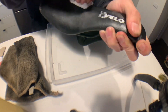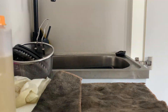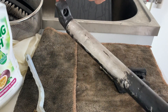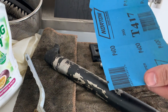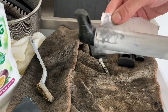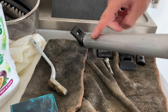Cleaning the rest of the parts — it wasn't too bad. I just used WD-40 to get rid of the stains, then some hand soap and moisturizer to finish it up. And then for the stem — WD-40 with the rust brush again to get rid of all the rust. For the seat post, just detergent and warm water. The seat post was pretty rough — it used to be black but had a bunch of scratches on it. I used 240 grit sandpaper to sand it down, then refined it with 400 grit. I actually tried 400 first to see if it worked, but it was taking too long, so I used 240 — it was way easier. Then just a little bit of WD-40 to seal it.